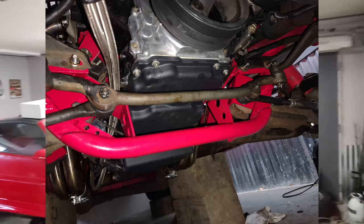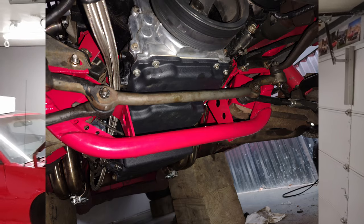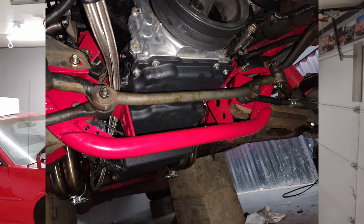I got the new black F-body oil pan installed — the one with the three stages in it. Once I got that on there I was able to adjust that center link all the way up and I've got all the clearance in the world for that front steering assembly. This project K-member-wise is actually done. Brake lines are all hooked up. I need to get the car back on the wheels and tighten the A-arm bolts with the weight on them, and then this portion of the project will be done. Coming up soon will be the subframe connectors, maybe the roll cage. Tracks about to open up in the next couple weeks. Thanks for watching, dadgummit. Stay good — we'll see you later.